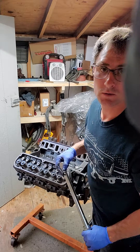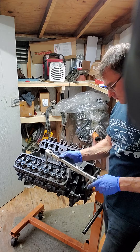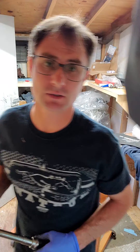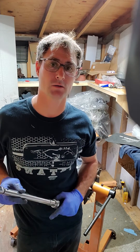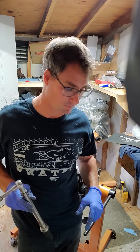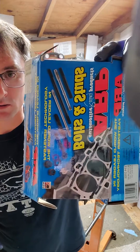There's your first round at 35. Then I'll crank it up to like 50 something, and then I'll end up at my final — my third torque cycle — which will be 70 foot pounds. This is the box I used.